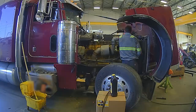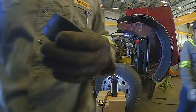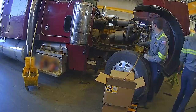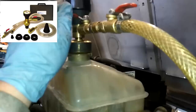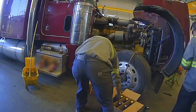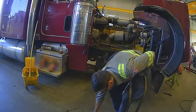You're just seeing a time lapse here of getting everything back together. We're installing the upper and lower radiator hoses that the customer had polished themselves — they actually looked really nice, and the whole job turned out to look really nice. One of the bigger pains was filling the cooling system. I always vacuum fill using something called an airlift — a very inexpensive and great tool I've had for about 10 years. It pulls all the air out of the cooling system and then sucks the coolant in, so you cannot get an airlock. Anything with an EGR or a sensitive cooler like a pre-cooler definitely should be vacuum filled. The problem we had: no 5-gallon buckets of coolant, so we had to use 1-gallon buckets, which makes vacuum filling much more difficult — but fill it we did.